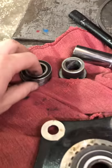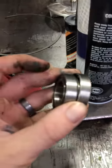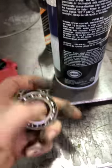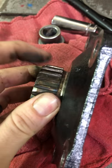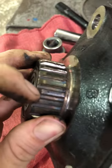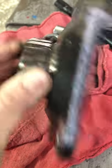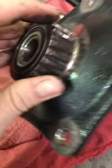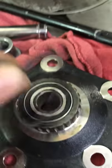I've seen these bearings come apart — just because they're pressed in, it's not an airtight deal. I've seen them come apart from just being dried out. I've also seen the spline get chewed up — imagine half of that spline gone from it jerking forward and not being lubricated. There's also an o-ring that goes around here, which I replace.